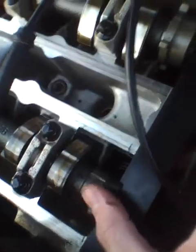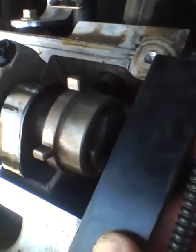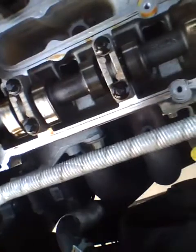You mixed them up. Or yeah, I'm sorry. Yeah, this is the exhaust cam. The exhaust cam goes in fine, and the intake cam barely is a hair off. Okay. Now go ahead and try and turn it up against the pin again. It's on it. It's on it? Okay. We will try one more thing.